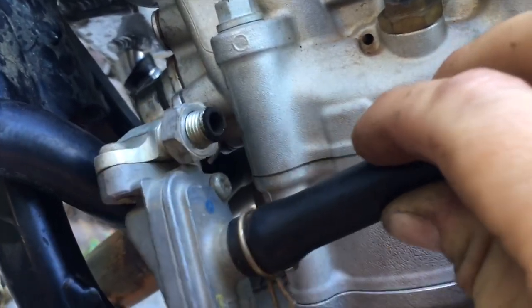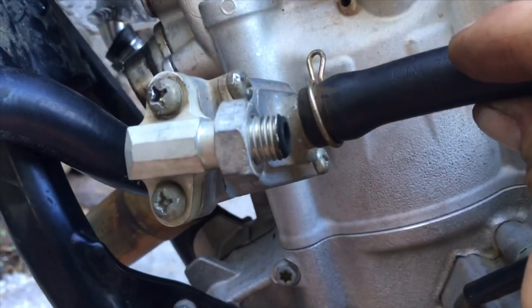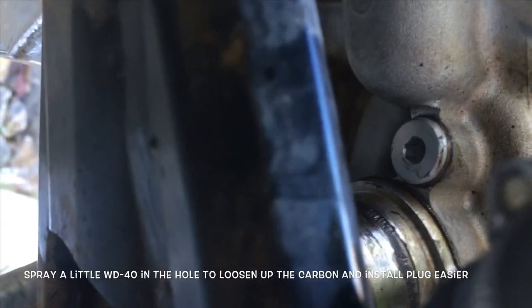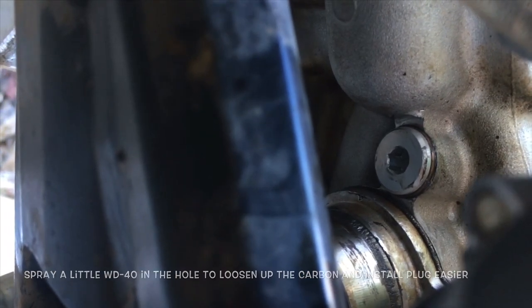You may need needle nose vice grips or something to help you loosen things. Basically what happened when I took these screws out right here, it allowed me to just turn it out of the engine — it had the clearance to just rotate out, so I didn't even have to use anything on that nut. Using the part number I supply in the description, install this aluminum plug with a copper crush washer into your head.